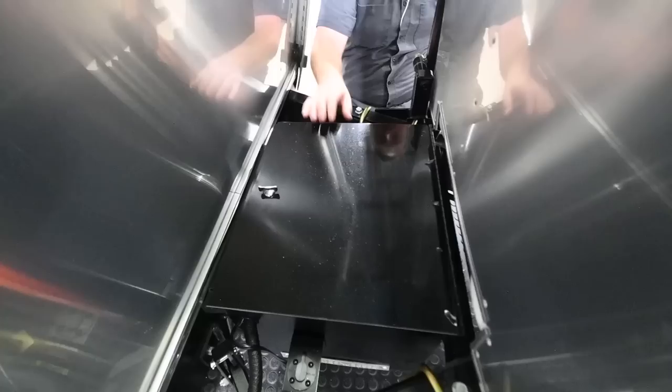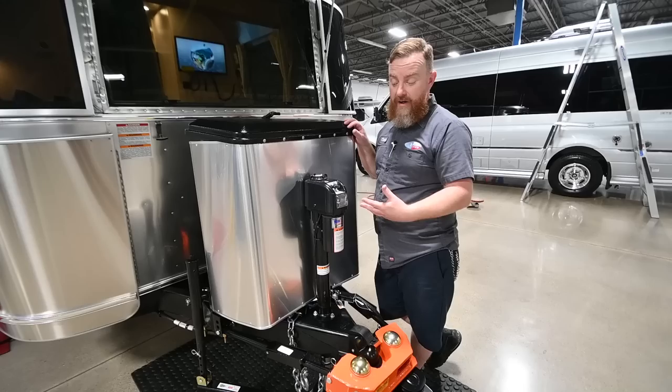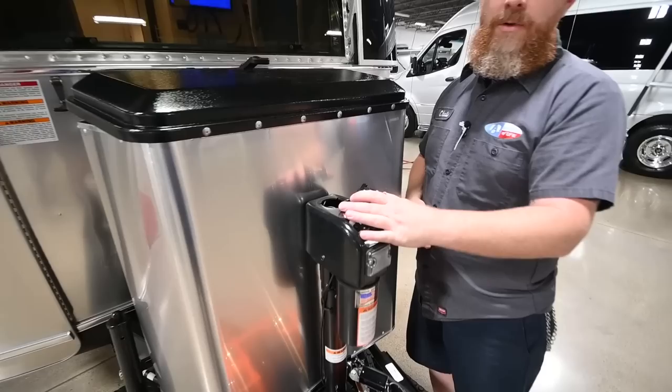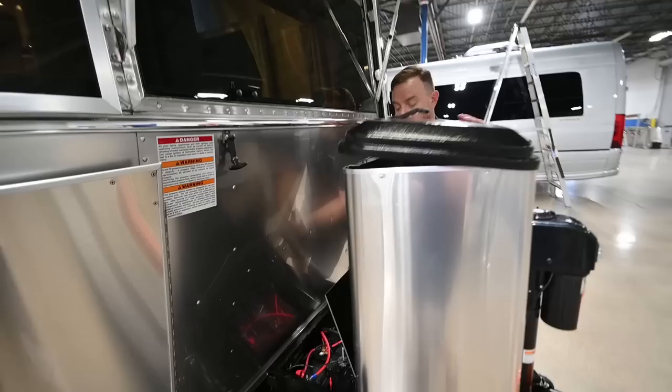The tongue jack on this trailer is power and it has a light. This tongue jack does not stop immediately when you release the trigger, so let it come to a stop before you reverse directions. If you go rapidly back and forth on that switch, the slow-blow fuse will absorb the amperage a bit, but you will blow the fuse. There is a manual crank that fits down here under the little bubble to manually crank it on or off the tow vehicle. If you have lost power, check the fuse first — the tongue jack is wired directly to the battery.